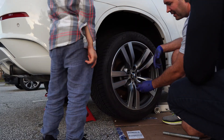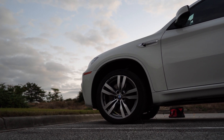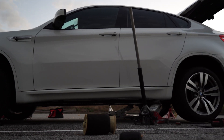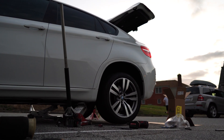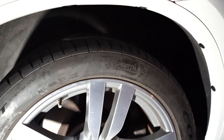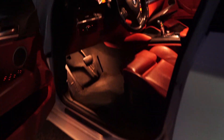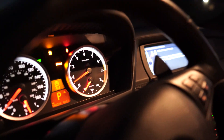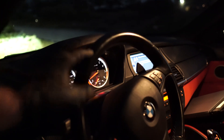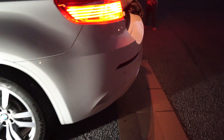Once the top is locked, pull the bottom portion of the air spring and lock it in place. Pop the wheels back on and lower the car slightly, maintaining the default suspension level. Do not drop the car completely onto the suspension, as you can punch a hole in the new air springs. Keep the car on the jack — I fit my hand between the wheel and the body to confirm it's not too low. Then reconnect the battery and wait for the pump to start. After a couple of minutes, when the system is filled with air, you can lower the jack stands completely and take the car for a drive.